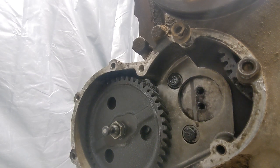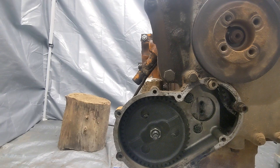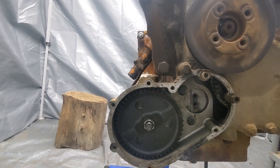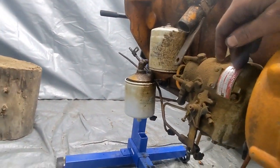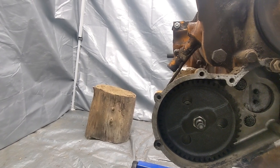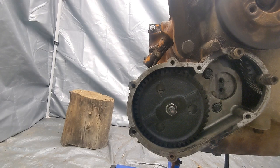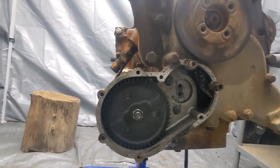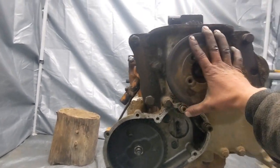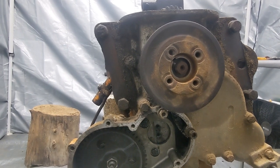The next step is to pull this whole cover off, but I have to have that pulley off before it'll come apart, so we're going to be waiting on that. This is connected to the camshaft, which is going to be coming out in just a minute. The fuel pump here is going to come off completely with the cover, so that's why it doesn't matter as long as this doesn't turn when I go to put it back together - it should mesh back up. We'll have our punch marks on there to confirm everything's lined up right.